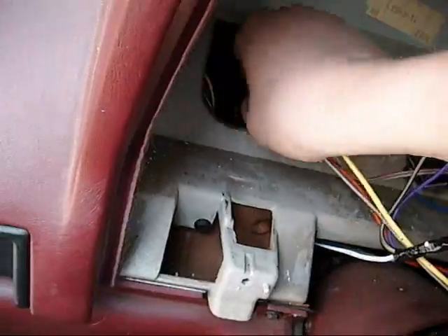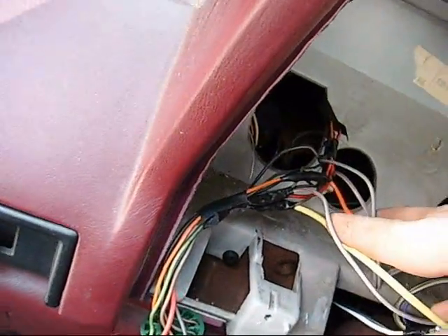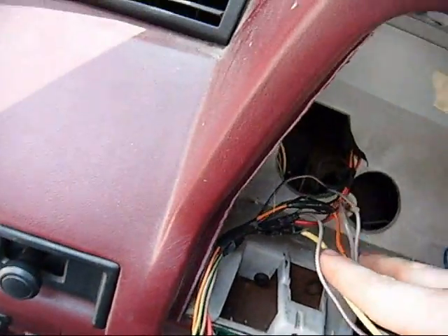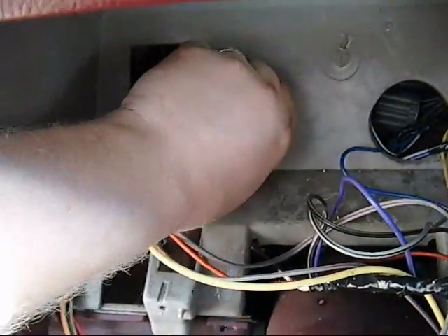Not beautiful but functional - the original wire connectors are still there and I've just tapped in, so I never actually had to cut factory wires. First-generation Shadows up to 1990 had a cable-driven speedometer. There's the other harness, all tapped in.